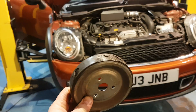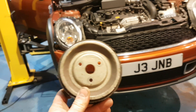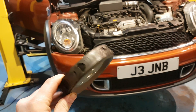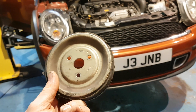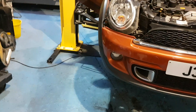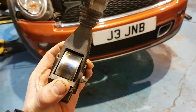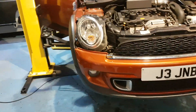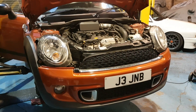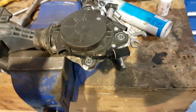I put it all back together, put the belt on, put that friction wheel in, and sure enough the noise came back — quite severely. The noise was so pronounced it sounded like the engine was going to fly apart. What actually happened was the friction wheel had seized up. You can see it seized up, finally let go, and done that damage to the water pump pulley. The water pump pulley has a rubber face all the way around — that's how the two grip each other. The bearing had gone and the item had seized up.